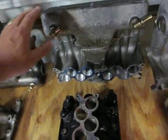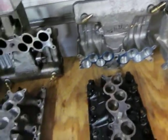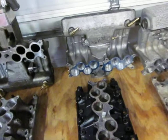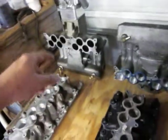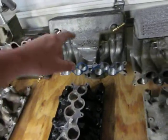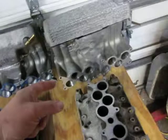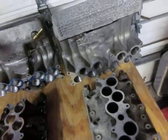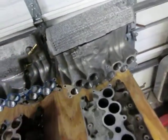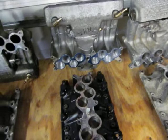So this upper is going to go back on the car. All three of them are going to be on the car at some point again for our dyno day, which we're going to do on the 3rd of November. I'm going to try all three uppers. I'll have the stock one with 80mm throttle body and 14 inches of runner length, then I'll put this one on which has been opened up but has a shorter runner length — this one is 12 inches total for the upper and lower. Then this one will be opened up considerably inside, fully ported the whole inside, keeping the stock runner length. That one should make the most power and still keep the most mid-range torque according to the computer program I have.